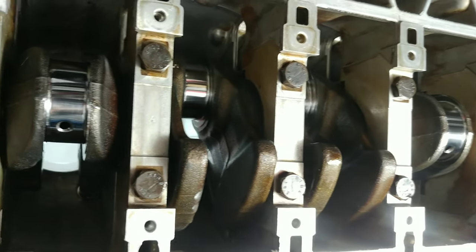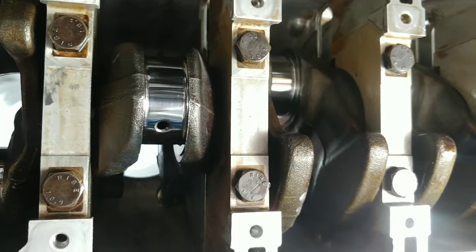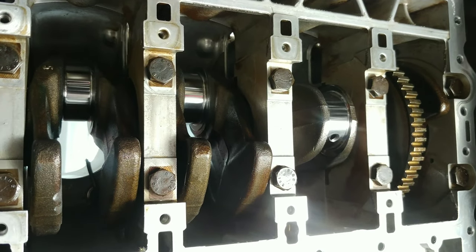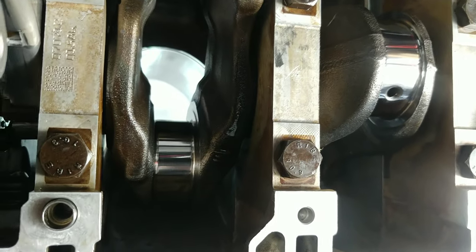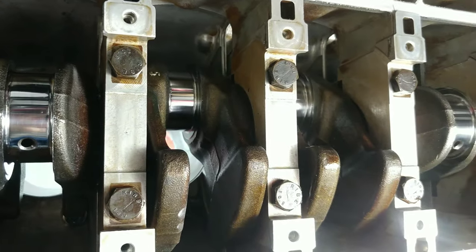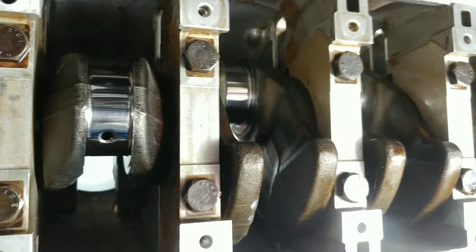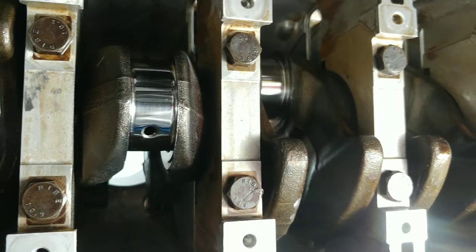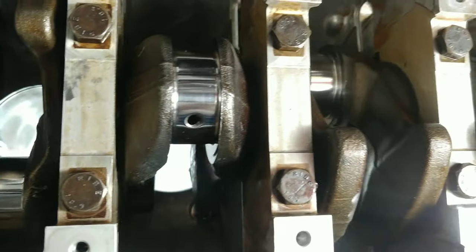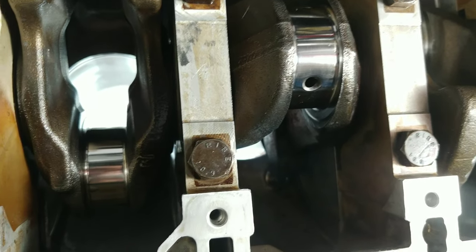That about wraps things up. Just so you know, I've probably spent anywhere from 8 to 10 hours sanding this crankshaft — it is not a fast process. It takes a long time and a lot of effort, but it's worth it: it saves money and saves you from having to pull your crankshaft. It will take many hours especially if you have badly scored journals. Don't forget you can use this process on camshaft journals as well to bring them back to brand new condition. Thanks for watching — stay tuned for my next videos where I install my big single turbo and button up the top end.